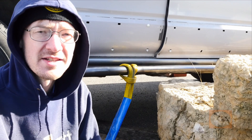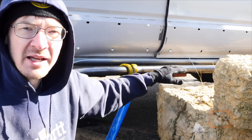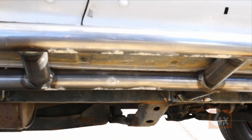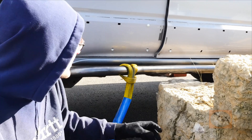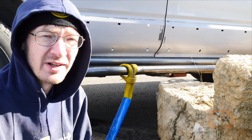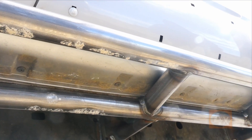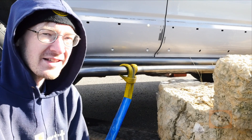We just did the 18-inch drop test on the outside tube of the hot rolled sliders. You can see there is a little bit of a bend on the outside tube now, and the main tube is also bent a little bit more. But with no weight on the slider, it's still not touching the body. When we pick it up with the forklift, it does touch the body now since there's a little flex in the legs, but still very easily able to open both doors. On the rear by the kickout, the fender flare might touch a little bit, but you would still be able to get in and out. Overall, pretty happy with this — 18 inches is a long ways to fall, that's a really hard hit. You are going to feel that in your back.